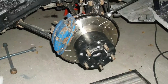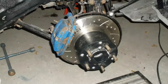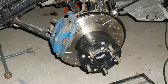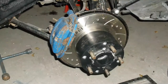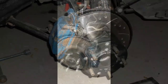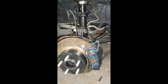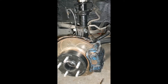Time to test fit the wheels. To do that you need to get the spacers on — this is a two-part spacer. The inner part mounts onto the hub and then the outer part mounts onto the inner part, allowing you to fit the wheels onto the car using the studs shown here. This is a rear wheel spacer, and this one's a front wheel spacer which isn't as big. I don't have the measurements for these, sorry. The calipers are a mess but I will clean and paint those before the car is sorted.